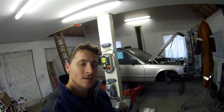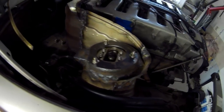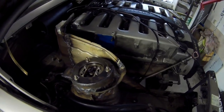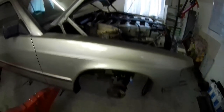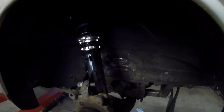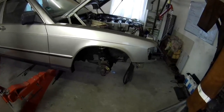I've got the front suspension mounted and rebuilt. I've got a top mount installed with the BC suspension — the front strut from the BMW E36 is mounted as high as possible. This is the highest point, just half a centimeter from the hood. I have some adjustment range to go about 5 centimeters down, depending on how much the spring compresses under weight. I've got a heavier spring on the front.